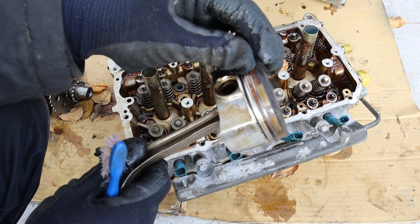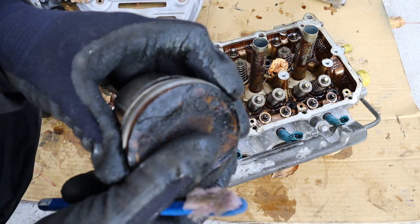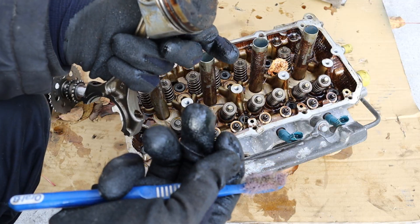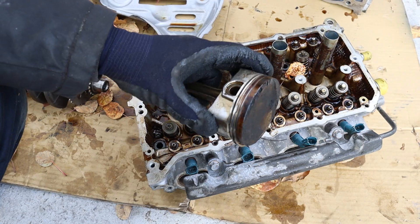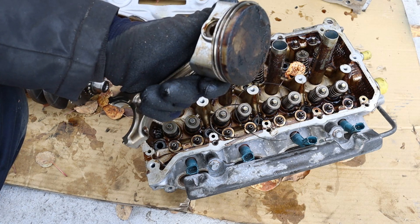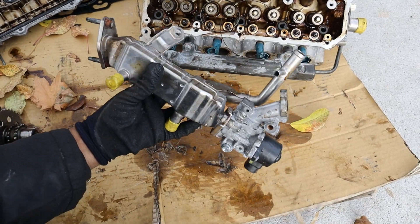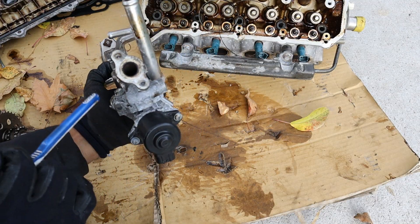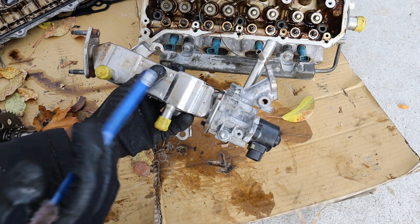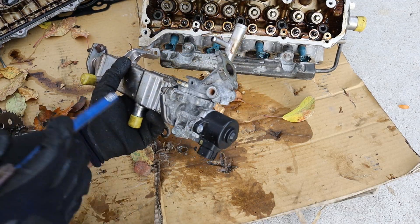As I've ranted before, the main issue with these engines is these really thin, low tension rings. This oil ring is like a one-piece unit with a little spring that sits behind it. After a while, carbon starts to build up, these rings are just too thin and they can't handle it, and you end up burning oil because there's nowhere for that oil to go — this thing is just so thin, like a piece of string. Toyota issued technical service bulletins for not only this engine but the 2AZ engine, which also used to burn oil. The EGR was also a common issue — this part is the cooler and this part is the actual valve. You can see there's a little bit of flaky stuff built up inside, and if these clog up, it's going to make your oil burning problem worse — you basically have more and more oil being burned, thrown back into the engine, closing that loop.